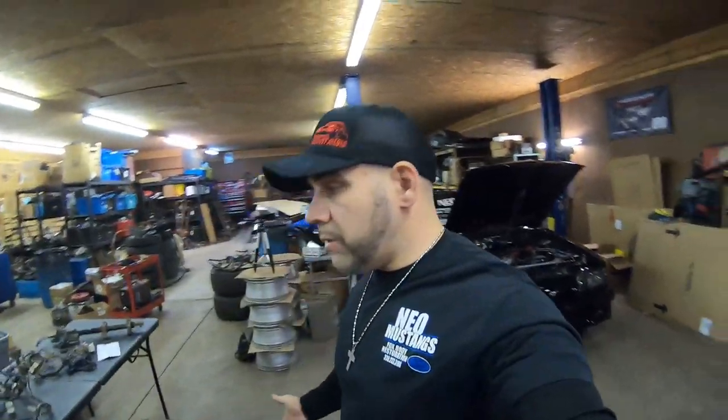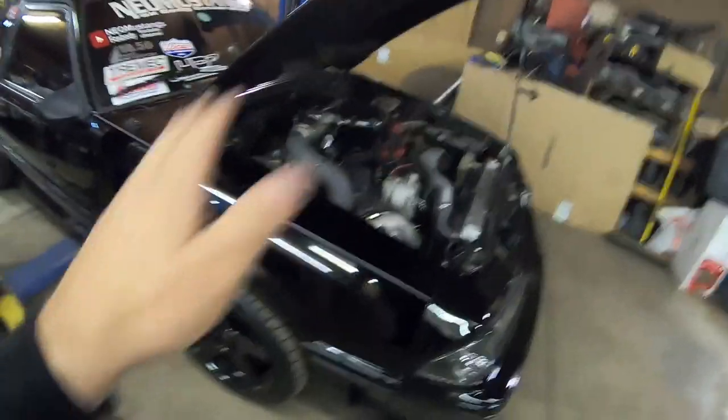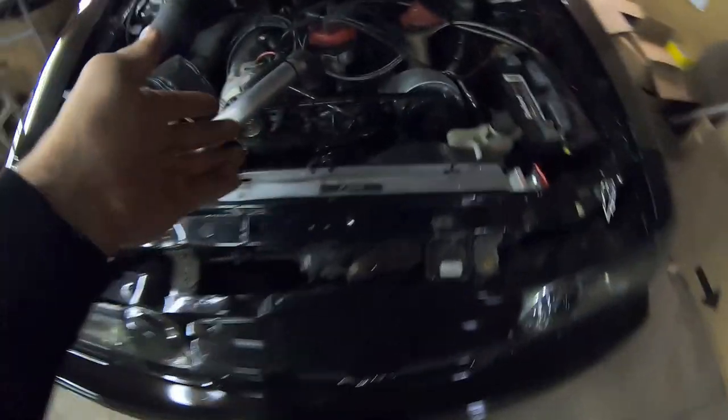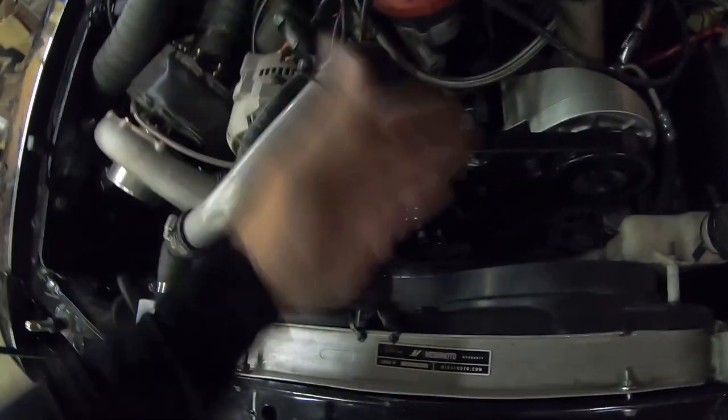We're talking about 30 years of overloading a battery and fuse box setup. When your fox body starts to smoke underneath the dash, your dash harness might be having wire issues — you don't know who tapped into that fuse box or how many years ago. If you're just getting into fox bodies, that's a pretty big no-go when it comes to powering things. These contour fans pull a lot of power and require a 3G alternator — the car's wiring is still 35 years old, it's not meant for that.